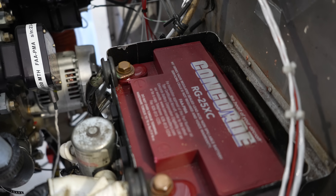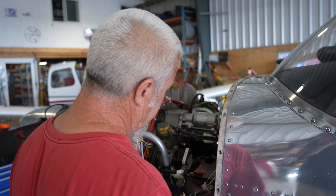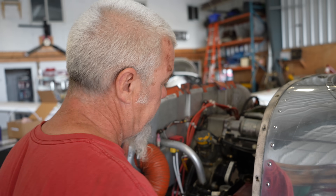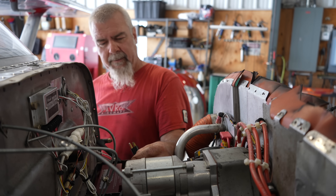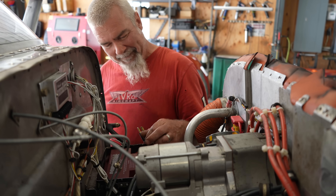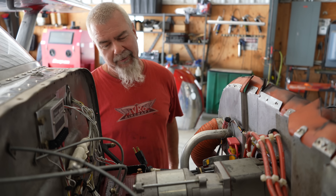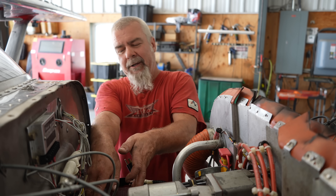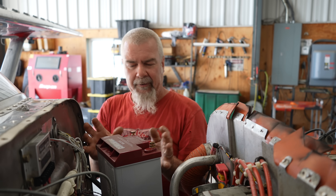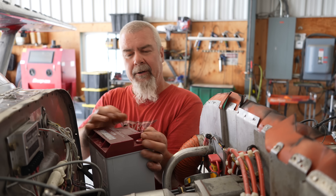So that's the old lead acid battery — let's get it out and have a look. It's lead acid non-spillable, not required to be serviced. There may be some AGM in there too. Pilots never complain about their batteries until they need a new one. These good ones last five, six years, sometimes more. Not to pick on the other kind, but the pink one you have to fill with acid — it's messy from a hazardous materials standpoint. This XC battery was sort of the best we could come up with, and they're good for a number of years.